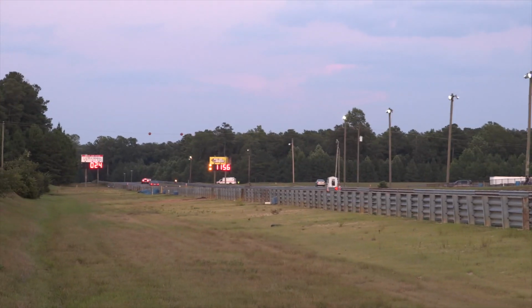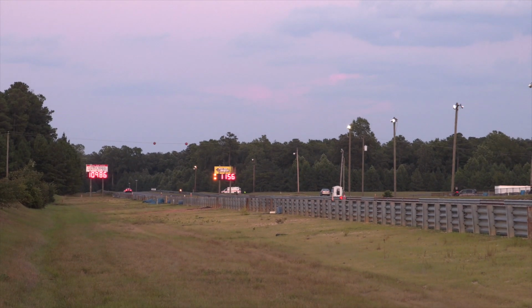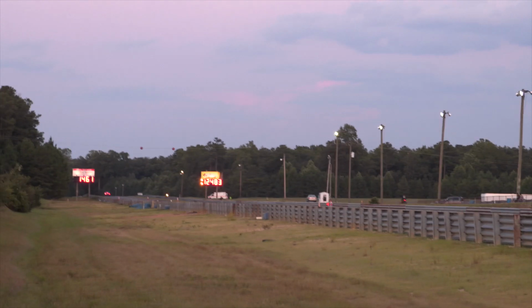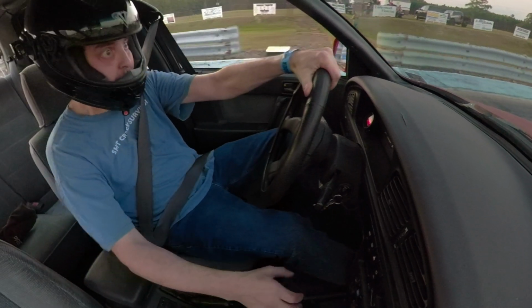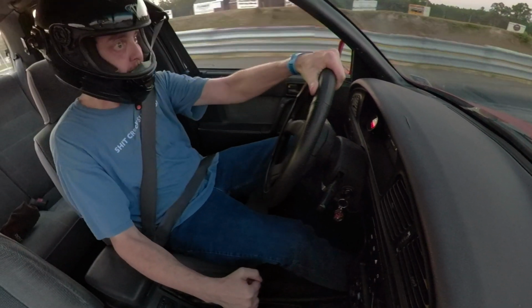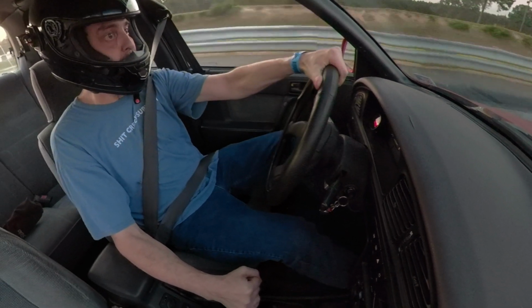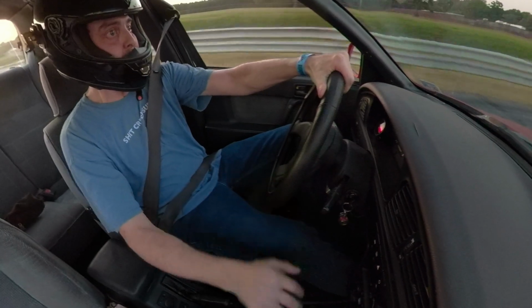Yeah, that was a crap run, but I'm just here for the data. I had a problem with my clutch switch and quickly adjusted my clutch pedal usage so that I could finish this run and save the data log. I had just turned on no lift to shift back in the staging lanes, and apparently my clutch switch is moved because I was locked into my shift limiter when I launched it. I've had to fix this issue before, and that's why I was able to identify it so quickly and adapt to compensate for it while half asleep.